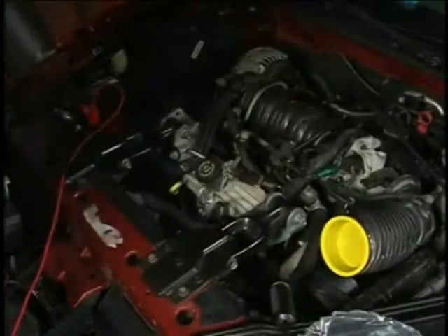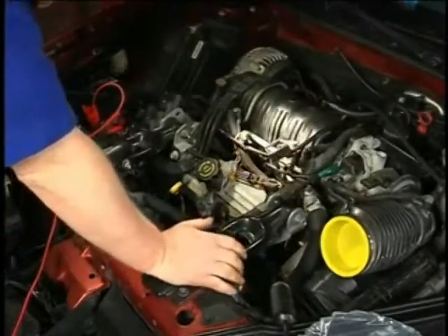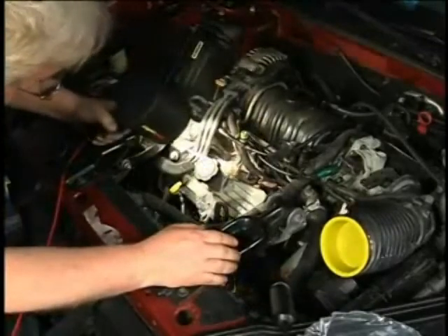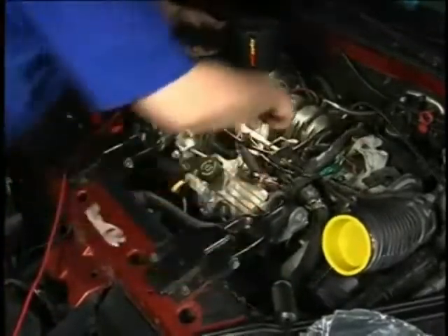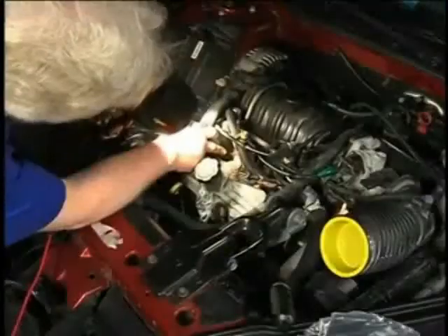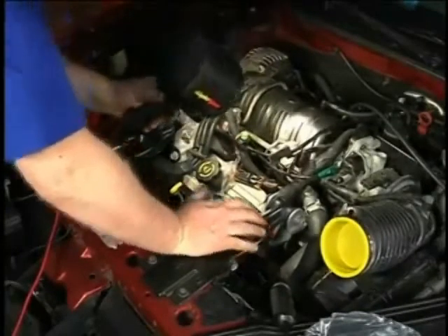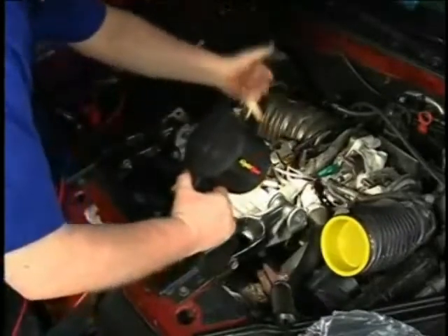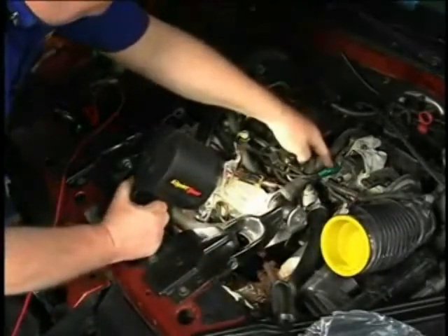Smoke's rolling — let's get the bright light on, and lo and behold we've got other leaks. I've got a leak — something serious here. I've got the intake manifold leaking straight out from the intake manifold gasket, and I've got an injector — looks like number two injector is leaking around the O-rings. And I've got a split right here too; it was holding when the other leaks were leaking, but now it's leaking a little bit around the split. So we definitely need a boot, injector O-rings, intake manifold gasket, a fitting on the intake, and a new valve cover. We've got some work to do here — and a good sale too.